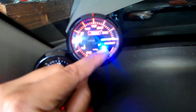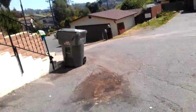Alright, so it has clocked right below 30 PSI. So at the 25 mark, we hit right about 30 PSI, a little bit right below 30. That's actually exactly where I wanted it, and that's pretty good. It says in the instructions that this is just a guideline. It's hard to make a set number because weather changes and a bunch of different factors come in. So 25 on mine essentially reads 30 is when the Guardian Angel will kick on. That's where I really want it.